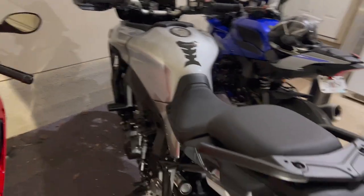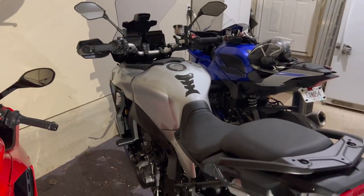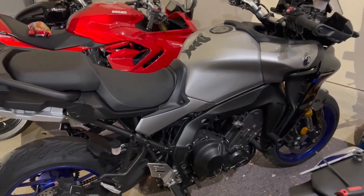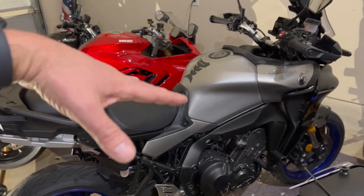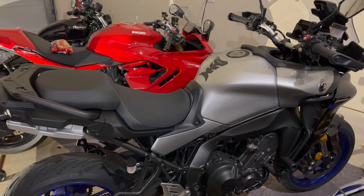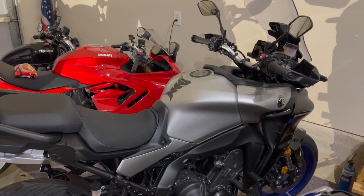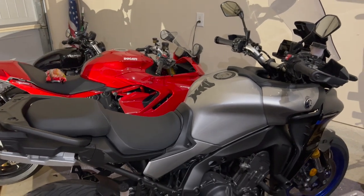So I'm gonna pull it off the rear stand and sit on it and see how it feels, see if my bar needs any adjustment. And then I'll do more of a ride review. I've got like an hour ride up to Fairburn, Georgia to GMD CompuTrack, and I have Kent set up the preload just to make sure that the bike's not, you know, wonky. I've got the preload and everything set where it needs to be, so I get the right amount of balance as well as suspension travel with no bottoming out. So I'll have a few hours of saddle time, and I'll try it in the low position, and then maybe I'll try it in the higher position and see how it works.